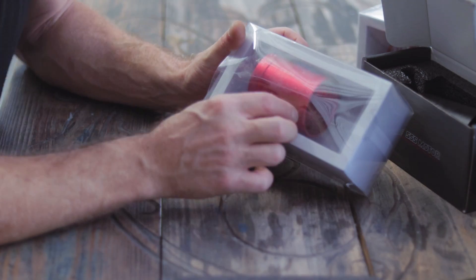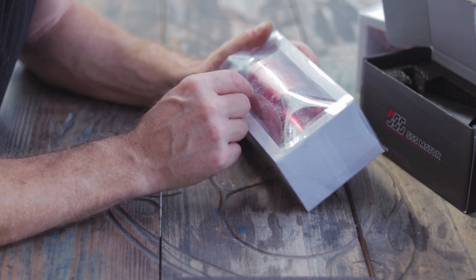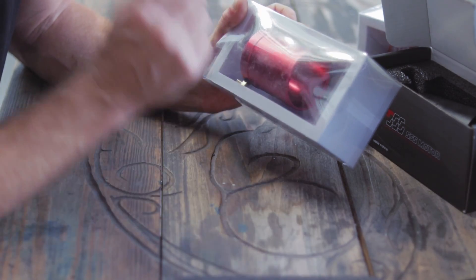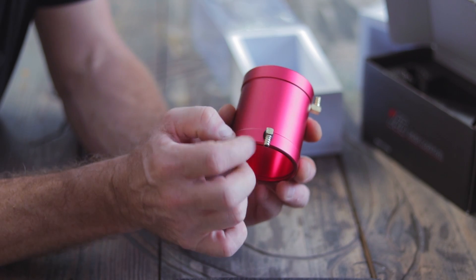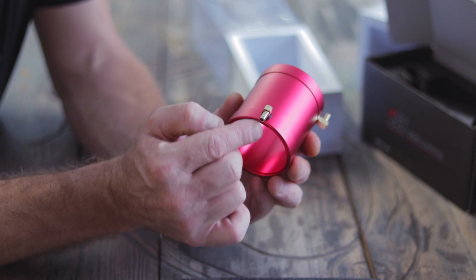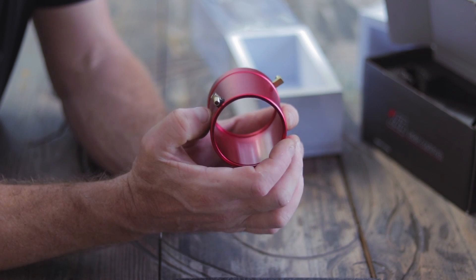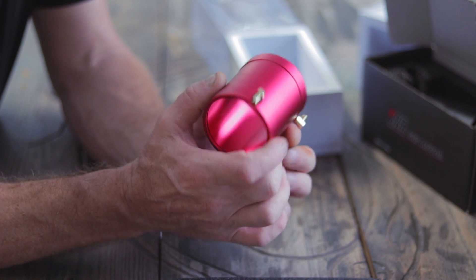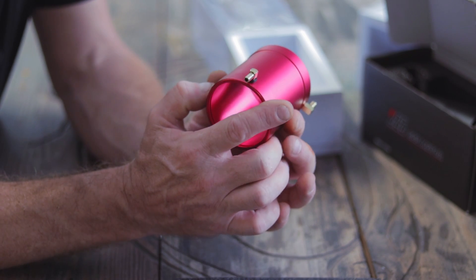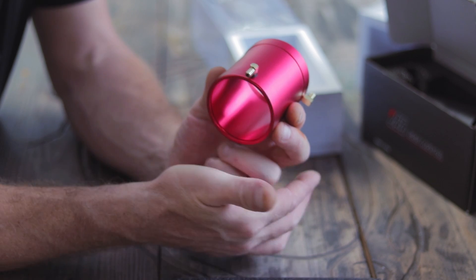60 bucks each for the water jackets. I think 70mm long. I've just changed the nipple — basically the nipples were facing the wrong way, so I've put that nipple around facing the front here, so it fills up with water as much as possible and comes out of the back one. If I have it upside down or one at the bottom, it's just going to run in and run out.